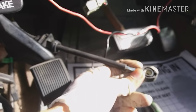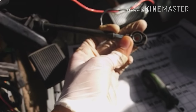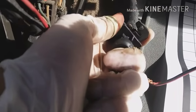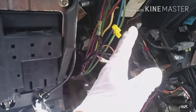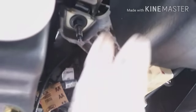Put a flat-head screwdriver in between the metal and the shifter. This plastic piece is locking the metal — you have to pull back and slide it out. It's hard to explain, so I'll show you once the steering column is down. The other connectors you can leave plugged; everything else will come down with the steering column.